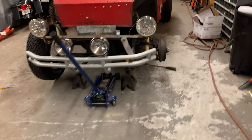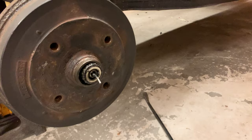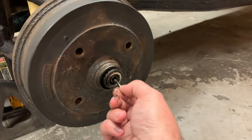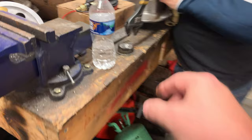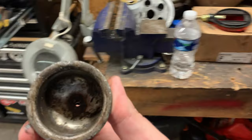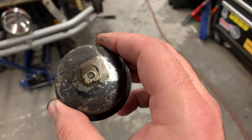And Greg's dad's pretty ingenious. We won't tell him, but this is a regular old Speedo cable for his aftermarket gauges, which is probably like a Chevy one or something, because it's that square normal peg. And I was like, that looks weird. And it's because of the cap. Where'd that cap go? There it is. So what his dad did back in the day is grab a new cap. No, he didn't. It looks like he welded the hole up. Flip it over and look on the inside. You can see where it's been burnt. That's pretty funny. So he welded the hole up on the stock one and then made a little tiny square peg for the newer cable.